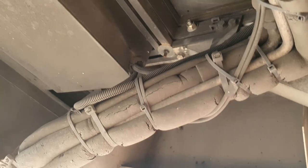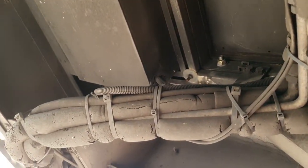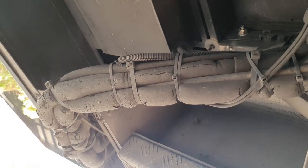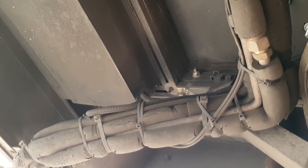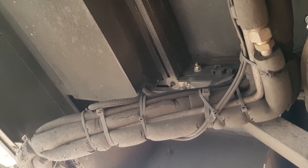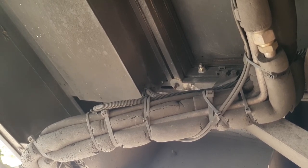Then I'll work my way to the back left corner. As you can see, there's some electrical connectors here, which is a good time to mention that you probably shouldn't use a pressure washer on the bottom. You can — I know people that do for many, many years and never had any problems — but you don't want to get any water in the electrical connectors. Anything you can hold your hand in front of is a good reference for what pressure you can use.